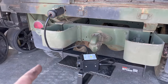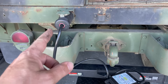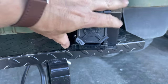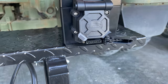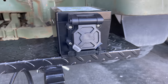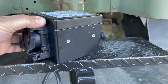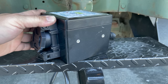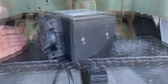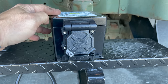Putting a trailer hitch on your truck is only half of the issues though. You also need an adapter to go from the military trailer plug to a civilian trailer electrical connection. This is the seven pin, and down here is a four and five pin trailer connector. You can either convert your trailer to run on 24 volt, which is what these military trucks provide, or you can get a relay box. This box here converts the 24 volt signals from the military truck down to 12 volt to be used with civilian trailers, allowing me to use any trailer without converting the lights or brakes to use 24 volts.